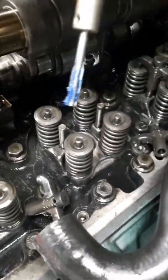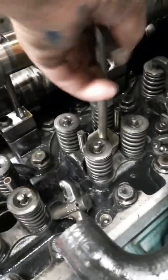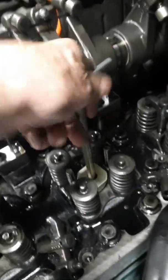The first step to pulling out these injector cups, which are down there, is to tap them out. This tool here — we have some grease on the tapper. Put it down in the hole and tap it out, going back and forth like so.